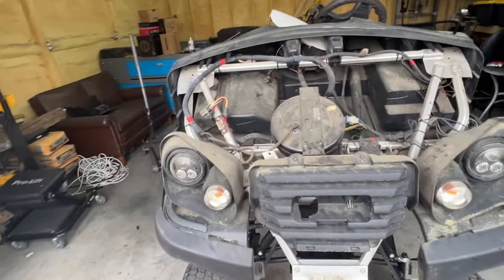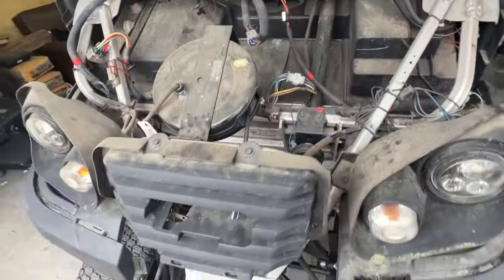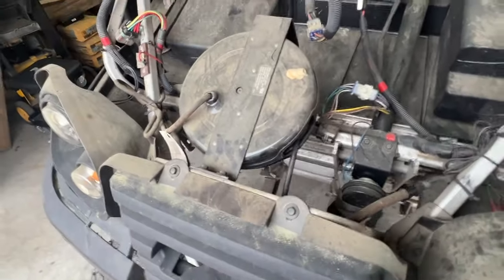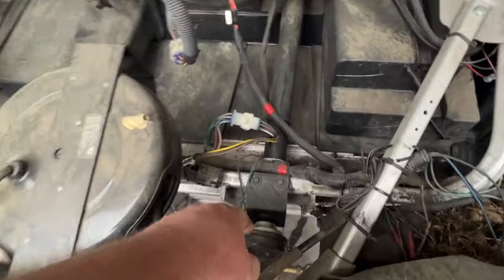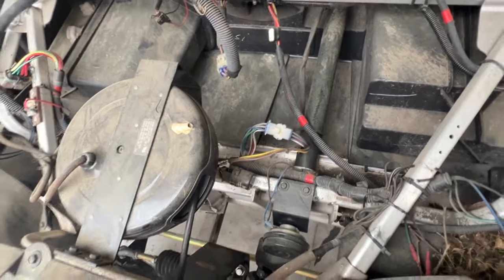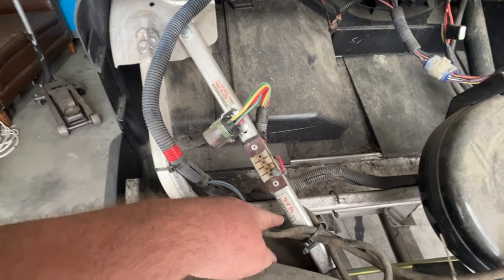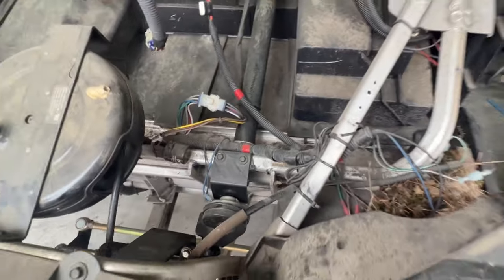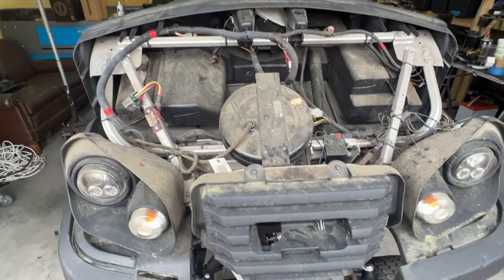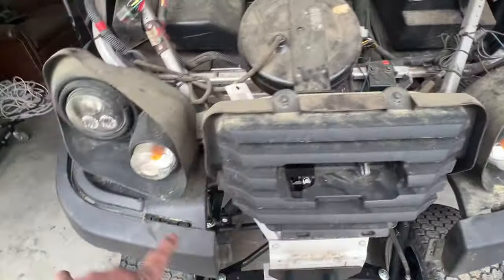Here — expose it. I'm going to come in here and probably wash some of this off and clean all of this as much as we can. This is for charging here. We're probably not going to do the cowl today — we'll probably do that in the next video because we're going to replace the horn and some other electronics. This is the 12-volt — not a fuse block but a 12-volt location, with a terminal and a negative going to the stock 16-amp DC-to-DC converter. We need to replace the headlights — I got new headlights — and I need to clean and paint these bezels, the grill, and this bezel as well.